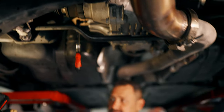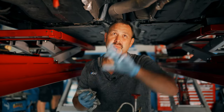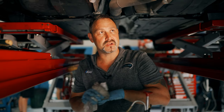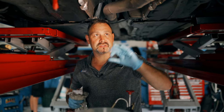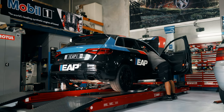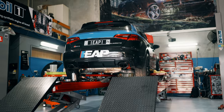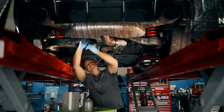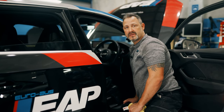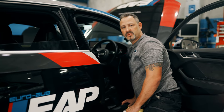What we're going to do is take the vehicle back down and turn the ignition on so that it primes the actual pump, because that pump right now is empty. If you drive off without doing this, you'll get a fault code. So we'll bring it down, turn the ignition on, cycle it, and let it prime. Just going to make sure that there aren't any fault codes since I unplugged the wiring loom. I'm running the adaptation values for the pump motor just to make sure that it learns its pressures correctly.